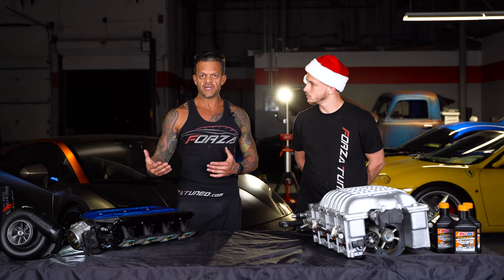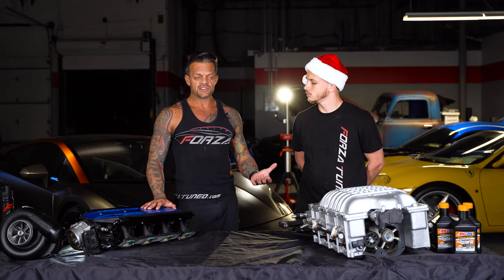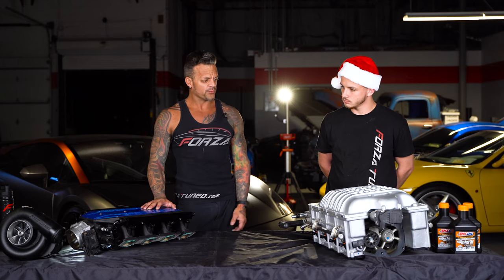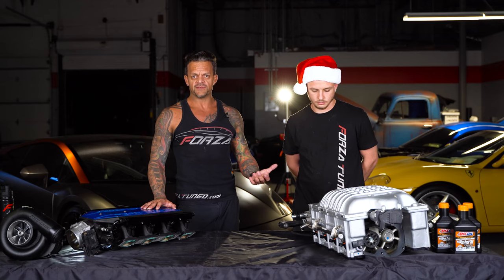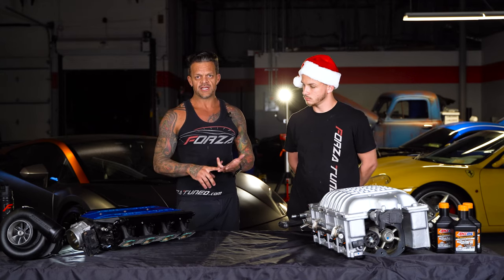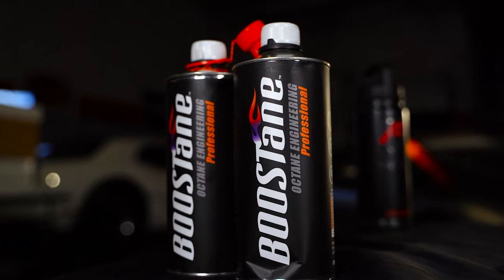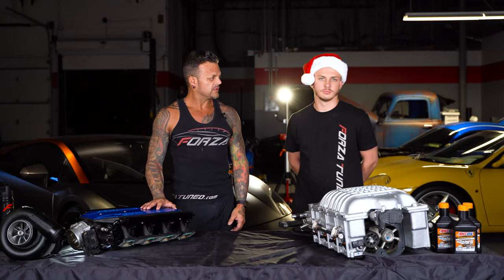You can't really oversize a blow-off valve — sizing comes much more into play with the wastegate. If everything is set up properly, you're not putting any unneeded stress on the system. These superchargers have much more parasitic loss, but as far as wear and tear on the engine, boost is boost — how you get it is sort of irrelevant. The primary sources of engine wear from any of these platforms come down to tuning: overly aggressive ignition timing or inadequate octane levels leading to spark knock.